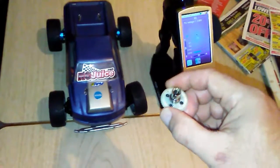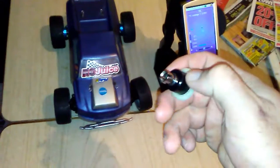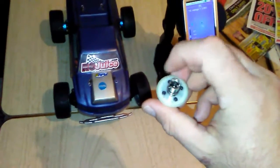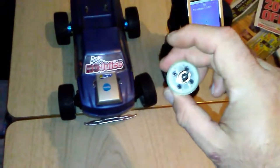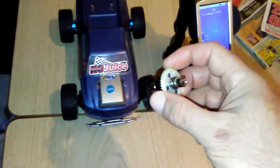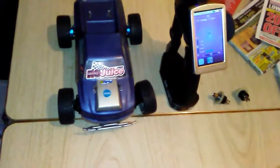So if you think your diffs are burned up, just check those four set screws and check the gears inside. If they're not chewed up, tighten those four set screws down really well — I'm not talking about cranking them down, but tighten them up. They feel like they're brand new diffs.